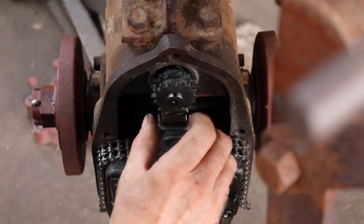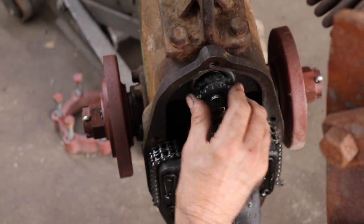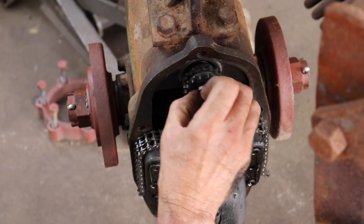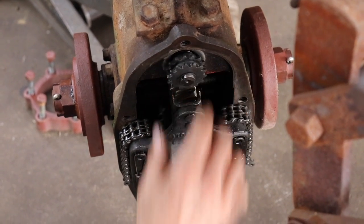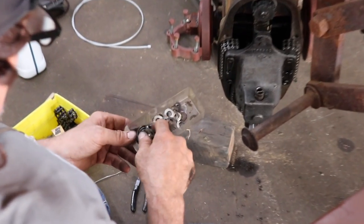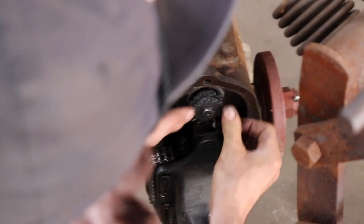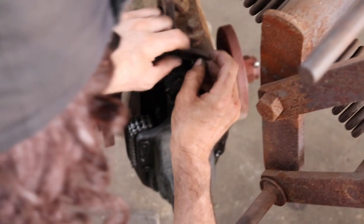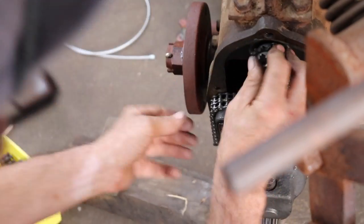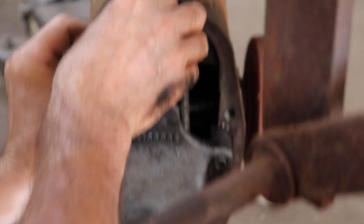And I noticed that the shaft was kind of spinning on the inside of that bearing. So I got a thin spring washer I think I'm gonna stick behind here to put a little pressure on this. That'll probably help. Let me go find it. All right, I dug in my collection of spring washers. That's why I gotta save all this stuff. You never know. And I found one that fit on there. Look, nice and springy tight. All right, let's get this chain hooked up. Let's get that gear oil put in there. Now you'll see that chain was stretched a little bit.